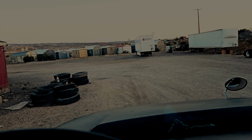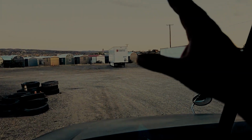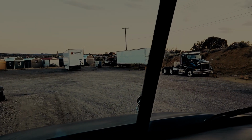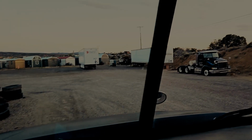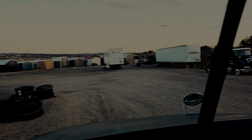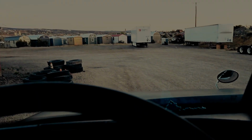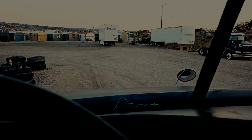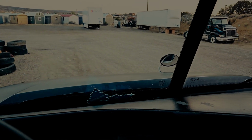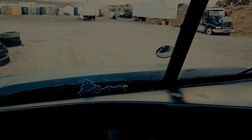Okay. Tell the examiner I'm going to inspect my windshield to make sure that they're properly mounted and secured on both sides. They're free of any cracks, any dirt, any illegal stickers. There's nothing obstructing the driver's view. You're going to demonstrate that your wiper blades work and that they have fluid.